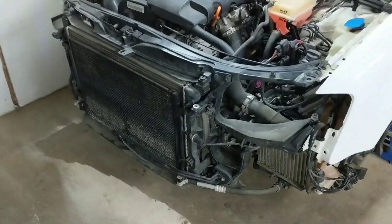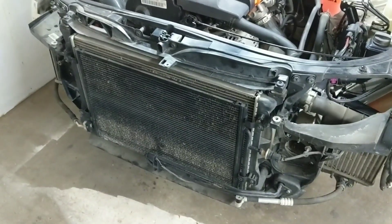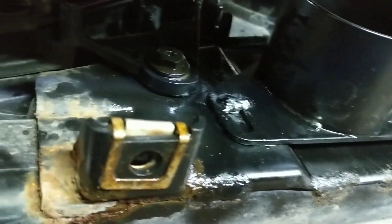It's a new day. I'm trying to do a little bit every night, and what's going on right now is that I'm attempting to not disconnect the AC system or drain the coolant. My goal is to sneak out the lower core support without having to detach anything. What I found is that there are only two T30 Torx screws that actually hold the back of the fan shroud to this lower core support, so I'm hitting them with penetrating oil to get these things out without a problem, because I won't have any room to drill them out if it goes wrong.